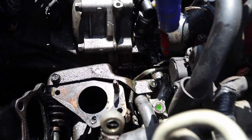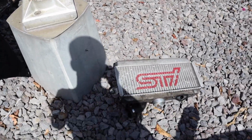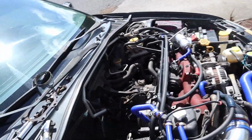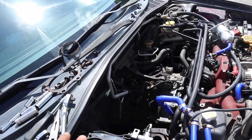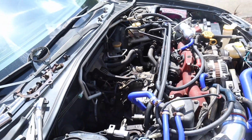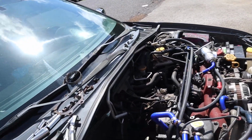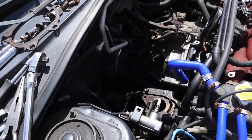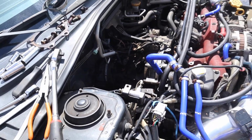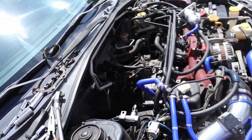But sadly, can't. So the only thing we can do is pour some gasoline inside the intercooler and wash whatever oil is in there. And I think that's pretty much about it. That's all we can do, honestly. I'll go ahead and take this boot because I know there's oil right there, and maybe clean up around here, put the hood back in, wait until the new turbo comes in, and then we can slap everything back on with the new gasket. And she'll run, not really 100.